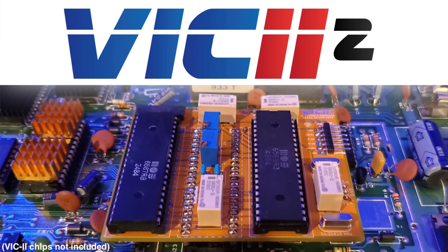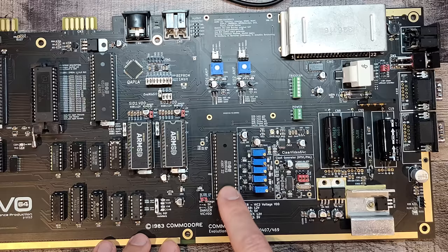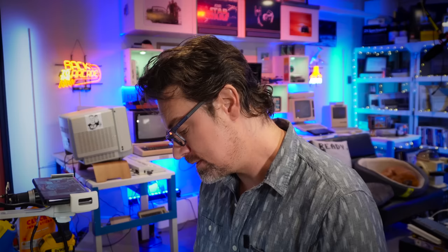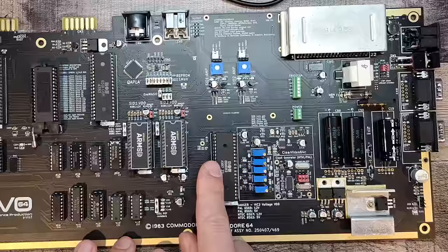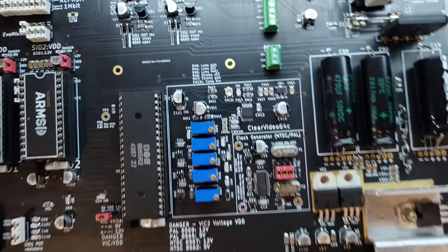Now, some of you will be familiar with my VIC-2 squared, which is the VIC-2 PAL NTSC switcher board. By the way, we recently made that open source as well, and you can find all the details at my website, linked in the description as always. But on this, you can put any kind of VIC-2 chip in here, PAL, NTSC, any revision, any model number. And you can see this one that they've kindly supplied with the board was built in week 43 of 1987. This Commodore 64 is PAL. But on this, if you want to put NTSC in there, you just configure it with these jumper settings here, and it'll switch for you.